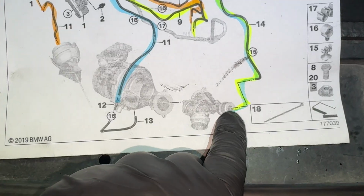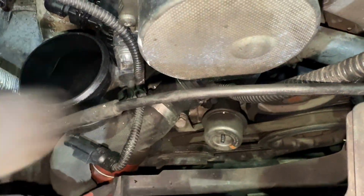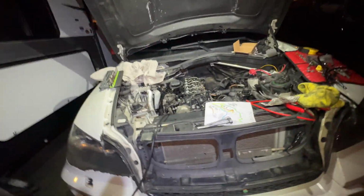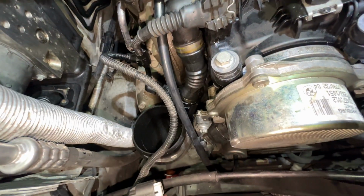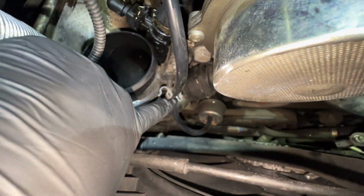So we're going to start at this hose here, which is this one here. And that runs all the way back to that actuator that I showed you in the beginning. So we're going to start by running this hose down. Then we have all this hose, which is perfect, so we can kind of route it however we need to, and then we'll use the extra hose to proceed. Now that it's kind of routed, don't forget your heat shield deal, and then leave yourself enough slack to make sure it's routed nice. Unfortunately, it's not really going to fit in these clips. It might, but we're going to leave it in there for now. Route it this way towards the back.